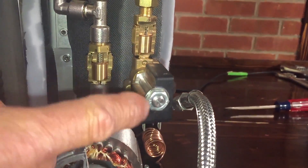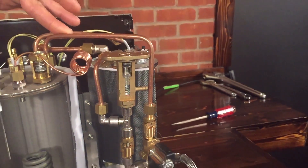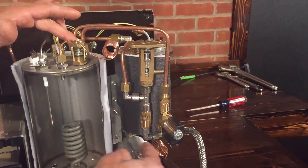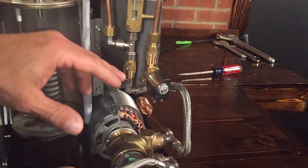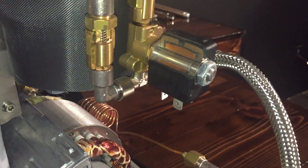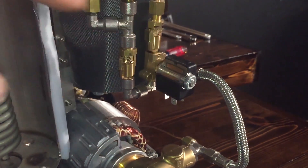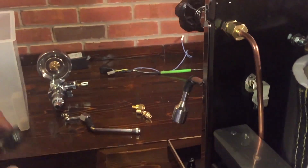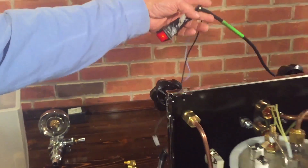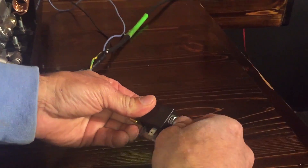The other direction of water goes through this solenoid valve, through this check valve, through the copper tube, and fills the steam boiler. The solenoid valve — you can see inside since it's cut away — is basically just a magnet. When it energizes, it pulls a little plunger open. We'll bring a demo unit up front to show you what they look like inside, in case you're curious.